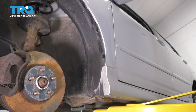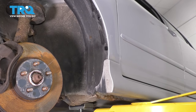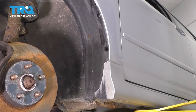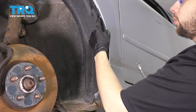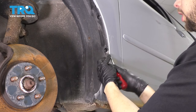To start replacing this fender liner, I want to start at the back right by the front driver's door. Of course, if you're doing this on the other side on the passenger side, the process will be identical. Either way, you'll notice that there are several push clips that look like this, whether yours are still the factory ones or, in my case, someone replaced them already.